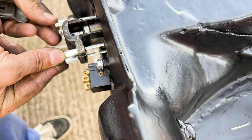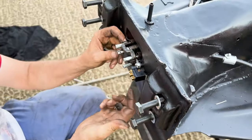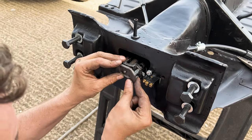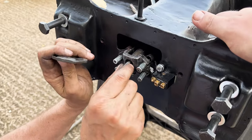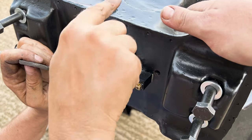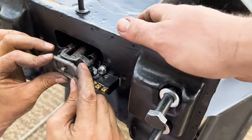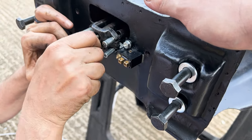That's right. Like that. Okay, so then we have the cover plate that holds that. I think the reason for this cover plate is for the adjustment of this. So that's how you adjust your handbrake through here, which moves that rod further and backwards. Agreed? Yeah. That cover plate fits onto there. That wants to come out as far as it can really for now.